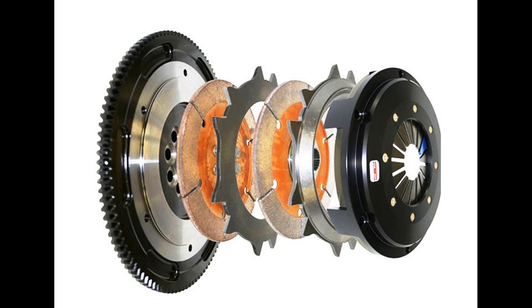Let's discuss where there is a need of high torque output, like in a pickup truck. A single plate clutch fails to provide that much frictional force between the flywheel and clutch plates that is required to provide such high torque. So in heavy vehicles like pickup trucks, multi-plate clutches are used. In two-wheeler vehicles like bikes and scooters, there is a problem of packaging due to their small size, so to fulfill the need of required torque output, instead of a large single plate clutch, a multi-plate clutch having small clutch plates is used to transmit power between engine shaft and the transmission shaft.